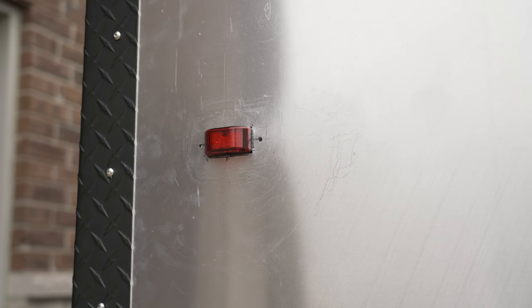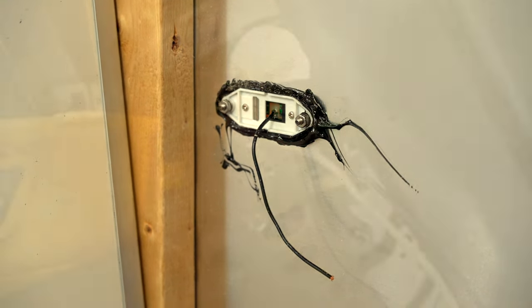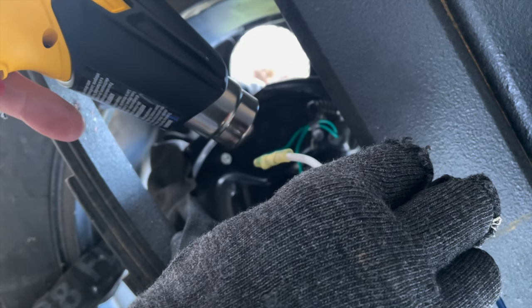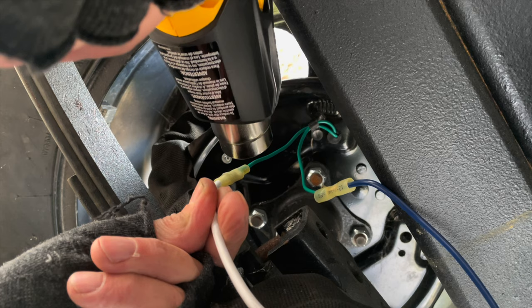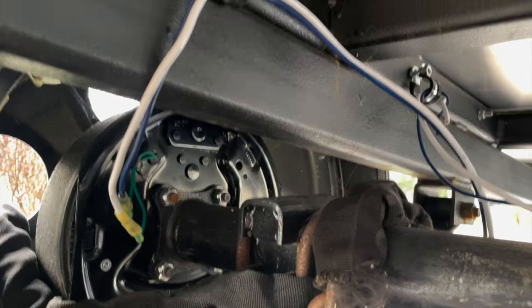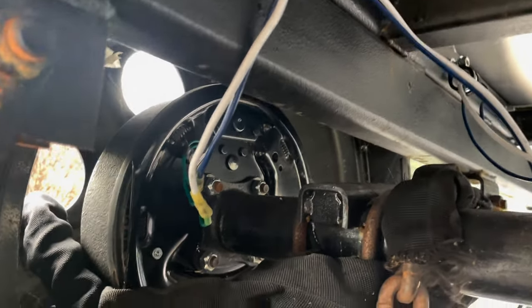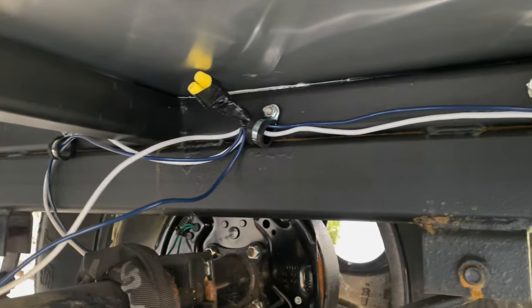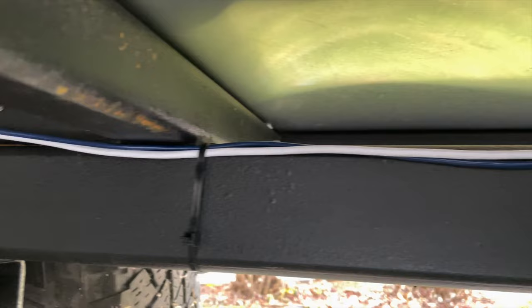I like the look of this better, and to seal all the openings, again more black silicone. I didn't film much of installing the wiring on the electric brakes mainly because it was difficult to get the camera there. There are two wires that come from the electric brakes — two green wires. One goes to a blue wire which runs to the junction box, and the white wire is the ground wire. I connected those with heat shrink connectors as well, again using black electrical tape as extra protection.